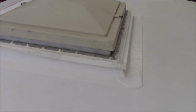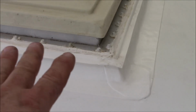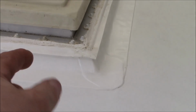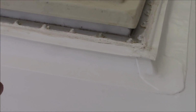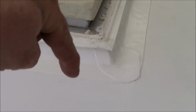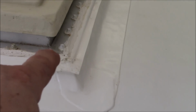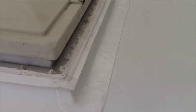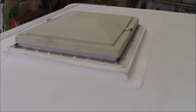when we put these on here and we put the M1 down, I don't use butyl here. So when that's flipped over, we load it with butyl. We set it down and then we put the screws in, and you can see all the caulking that's around the screws. Those are from when you drive the screw in, the caulking will start to pull up towards the head of the screw. And when it does, it makes like a grommet. And then you don't have to do anything to it. Leave it alone, it's done. And you don't have to send these things down to the bowels of hell. Torque them down, they're fine.